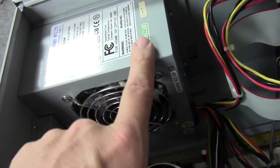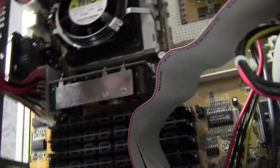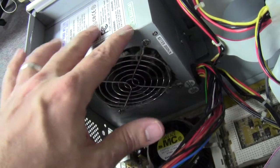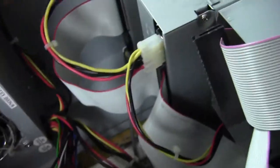I should look around to see if I've got power for that fan. Here's the power coming from my power supply — that's my power supply right there. Sometimes those burn out. This one came with the case so I did not have to buy a separate power supply. It would be easy to take out — I can see the screws. If I want to put in a different power supply, I could do that. Power supplies come with the cables and might cost 30 to 40 dollars. It goes right into the main board because most of the energy is needed by the main board, and some goes into the drives.